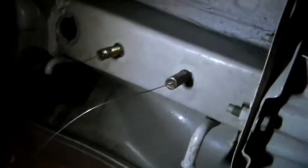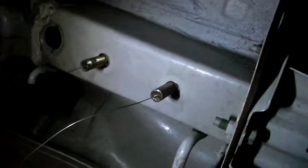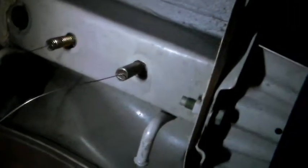What you have to do for this particular kit is you need to remove the exhaust. For my application, I actually had to remove the mufflers. The bolts bolt up right through here. You have to remove the grommet and bore out the hole a little bit. You can clean that up with a little silicone to prevent rust and it will look real clean. These little strings that you can see are so you can snake the anchors in — it's a very innovative type of thing.